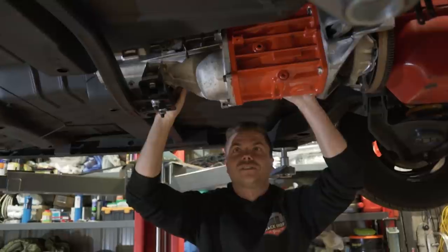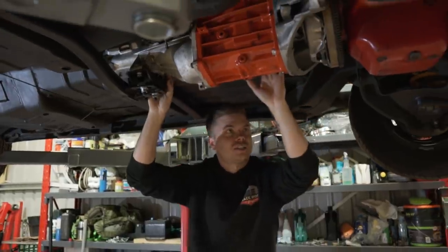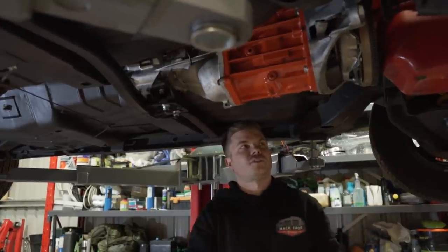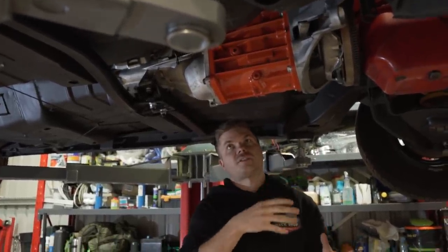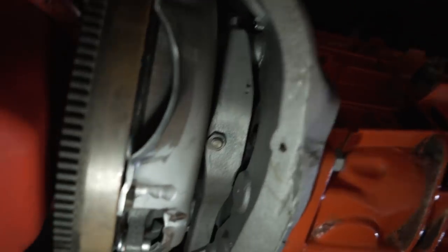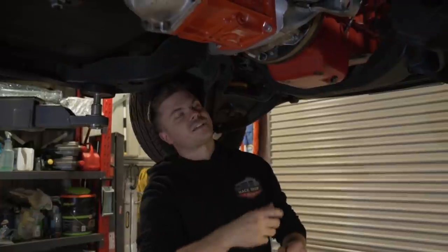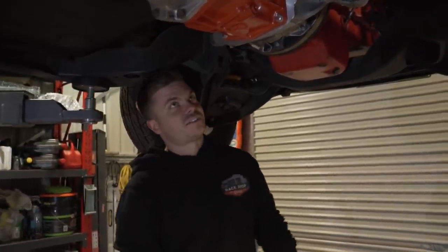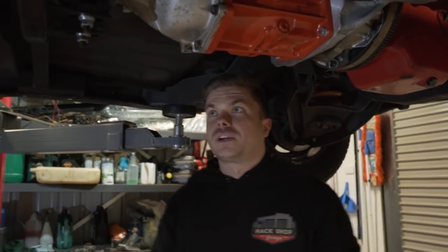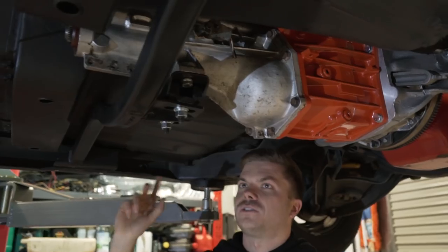The other night it was an absolute freak — what should have been an easy job really wasn't. We had it in and out maybe two or three times. The main reason being we didn't have a clutch alignment tool and we got it pretty close but just not exactly perfect. The other big issue was the clutch fork here — it kept popping off the ball. When we finally got the gearbox back in, it had popped off the ball and we couldn't get it back on. We fixed all that, called it a night, came back fresh. I spent time today buttoning up the cross member, tightening everything up.